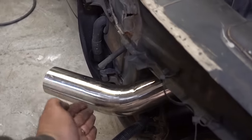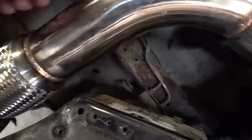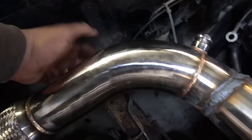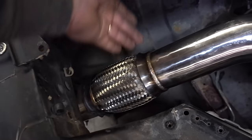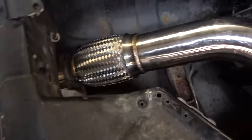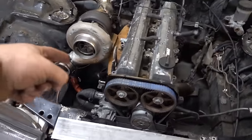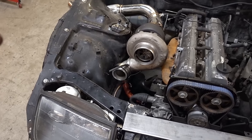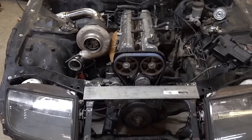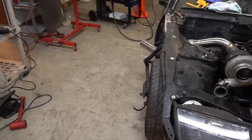I have that set on the level, so we're going to cut at a cool angle and try to make that large. Instead of reboxing this whole structure, I'm actually going to run a steel plate and a piece of roll bar tubing to the firewall to act as a strong brace, and another one from here back above and below that pipe. So we regain all the strength we need there without going through a bunch of sheet metal work, which is going to be tricky because the exhaust lives right there. Next episode: engine comes back out, we finish grinding and painting the motor mounts. We're going to clean and prep the engine bay, give it a fresh coat of paint. Then after that, prepping the engine transmission, getting the intake manifolds on, reinstalling it for the last time, plumbing fuel, and startup so we can make some fire out of that side.